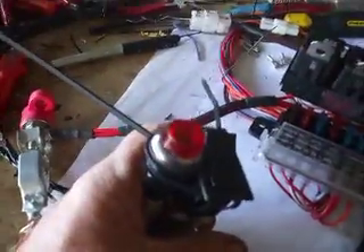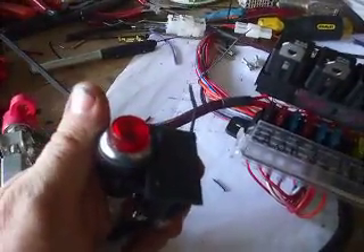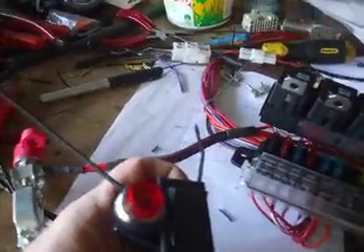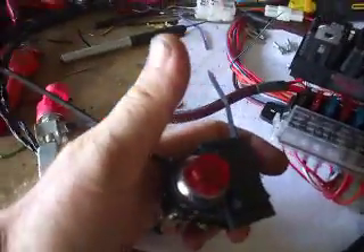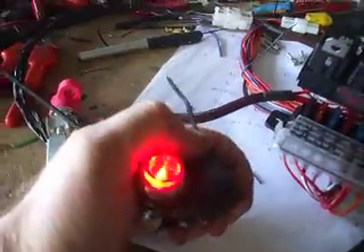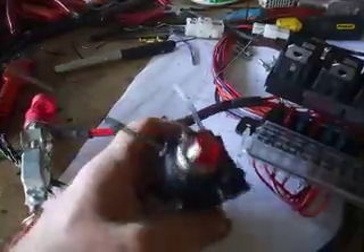A customer specifically asked on this one — it's going to be four-wheel drive again — so we've put a bypass on the fan circuit. At this stage it's on auto, so the computer takes care of it. If I turn it off, that means you'll be crossing water and don't want mud and water splashing all over the engine. Then we turn it on. You'll see the light comes on when the fan's on, just as a bit of a warning for the customer.